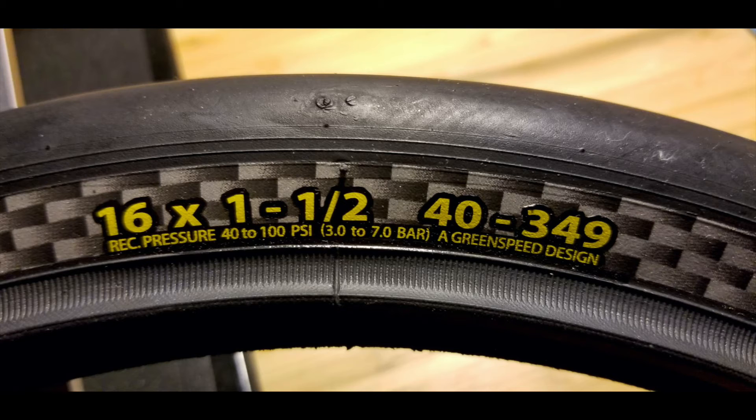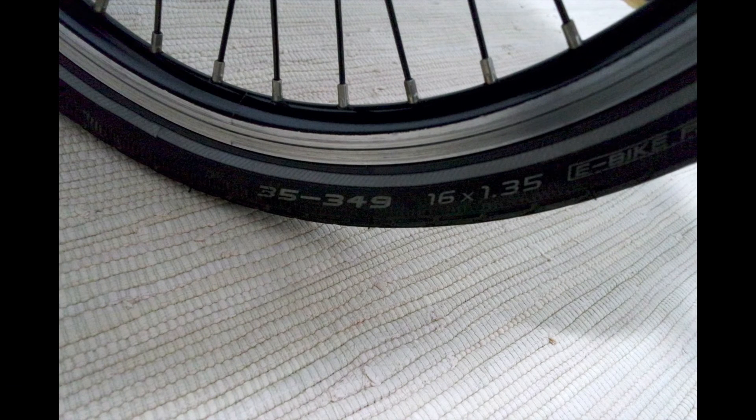If you are looking for tires to mount on the Brompton, do not look at the inches — don't look at the 16-inch designation, because 16-inch tires can come in all kinds of different diameters. You have to look at the millimeter marking, and the millimeter marking should be 349. The width of the tire at 40 millimeters is only five millimeters wider than the stock Brompton tire. The minimum tire pressure is only 40 psi, which is sensational — you can come down to half the pressure of the stock tire — and you can also pump it up to 100 psi for racing or exercise.